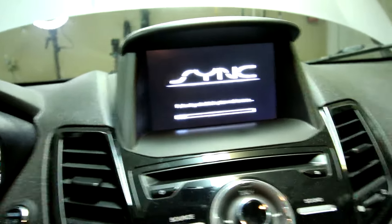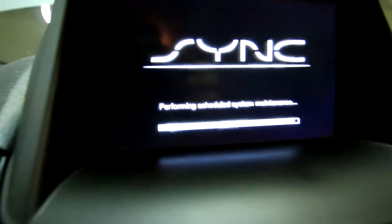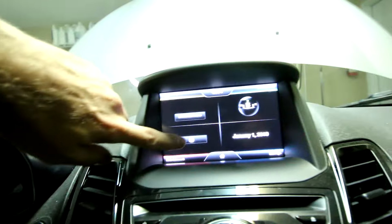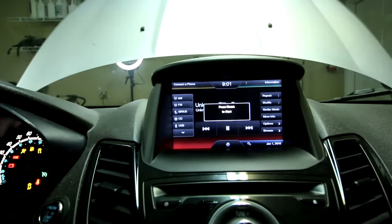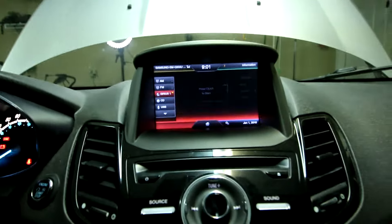Now let's go back inside the car and now we have the sync system setting up. The car is not that happy because it has to go through everything. There we go — 'Performing scheduled maintenance.' That's what you've got to do right there. You've got to make it perform a scheduled maintenance service on itself, which for some reason it does not readily do. You can't force it to do this without doing a battery pull. Now let's see if we can turn it on. Oh, I hear something! All right — we have sound, we have everything.